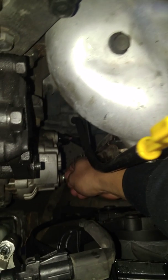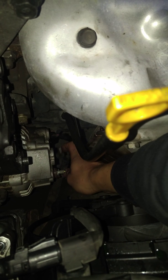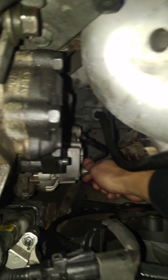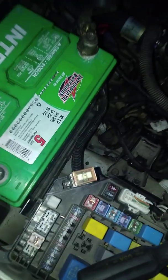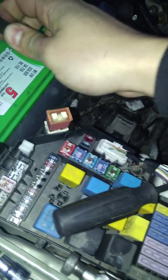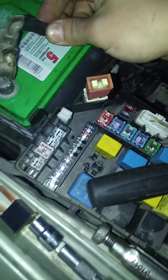So now what I'm going to do is just show you guys that, yes, the alternator is shorted. I'm going to blow the fuse. Remember, it blew a 120 amp fuse, so blowing a 30 amp fuse is going to be no problem. I just want to show you guys — with it unhooked, the lights turned on, everything's fine. Now check this out. I'm going to touch the insulated part here. Some of you guys think I'm stupid for doing this, but I don't care. Ready? Ooh! Bam! Crazy.